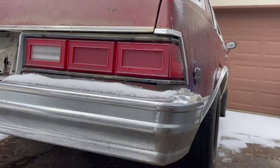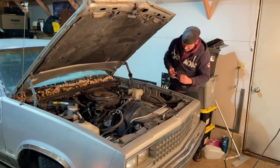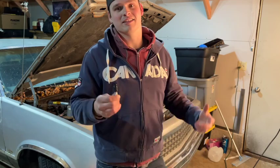Just pulling out this number one spark plug, seeing if she's fouled out. As you can see, that's pretty dark and gross. We'll spray some brake cleaner on it, wipe it off really good, and see if we can clean this up. We'll do all six of them, put them back in, and fire this bad boy up and see if she runs like a top.